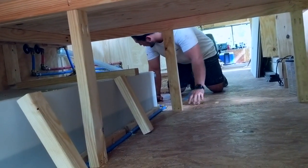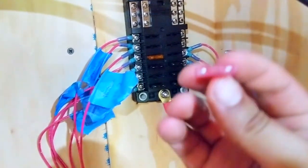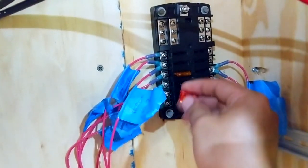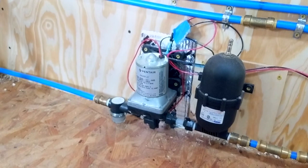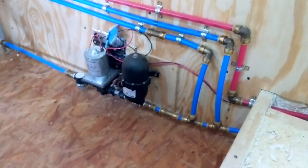Now the scary part — turning the water pump on. The water pump recommends a 10 amp fuse, and it's also recommended to be on a switch. Since I don't have a switch yet, I'm going to add the fuse and hope everything works. In the future we'll add a switch so we can turn it on and off, but in the meantime here's my terminal block — this top one goes to the water pump. I have a 10 amp fuse and I'm going to put it right here in that section. It makes no noise — it's not that loud — it's on. It sounds like it's going through the system. Oh, it turned off — because it's already pressurized so it has nowhere to go.